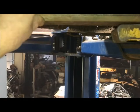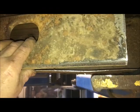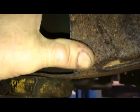So as I was saying, these trim sections that I made are the perfect fit to go right inside the frame rail. Those will fit in there nicely, making some sections that are boxed. And back here, where the original X started to curve out, I'm just going to make a little relief cut on the top and the bottom and knock that in straight and re-weld it. And that should be that. Should work good. All right, let me get that done.